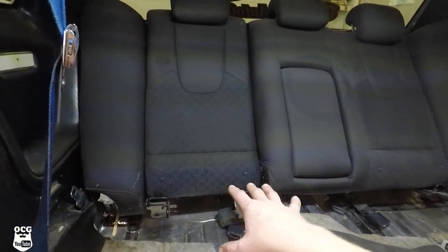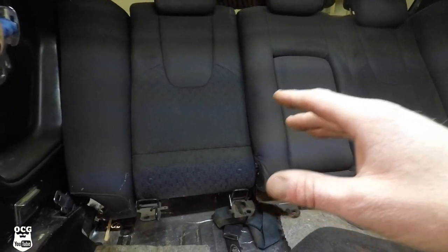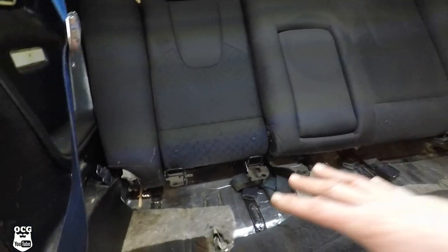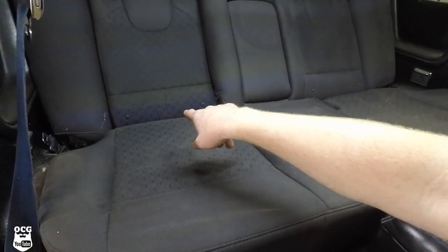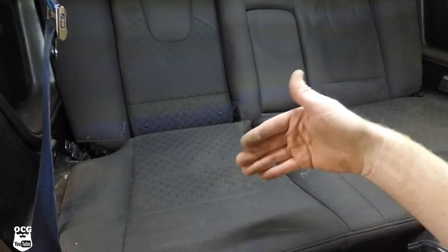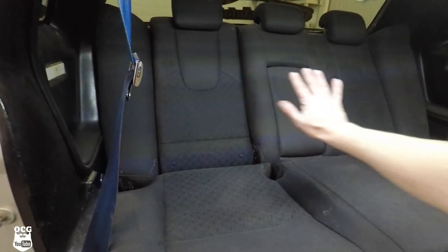And we're probably a good 6 inches or more between the back of the seat and the back of the framework of the car. So when we go to set our actual seat bottom in place, it wants to butt right up against the back of the armrest, which would protrude into the footwell compartment. No room there. So we're gonna have to see what's gonna take place to get those brackets either removed and build our own, or get them so that we can mount them up on the back side of the back firewall thing there.